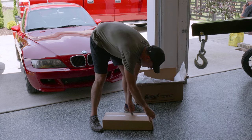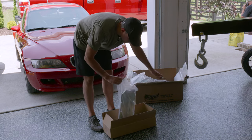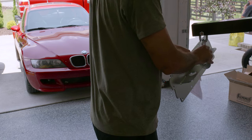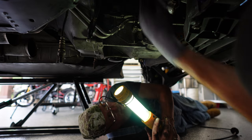In order to use the hoist to lift the engine I need something to hook onto, so I bought this valley cover lift plate specific to LS engines — it bolts right on to where the factory valley cover goes.